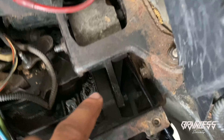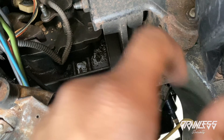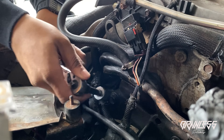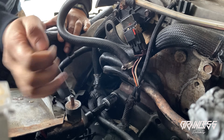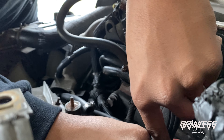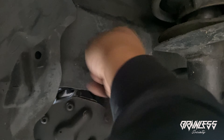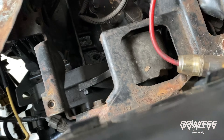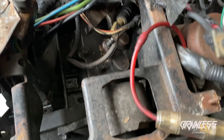As promised we are back at the SRT4. I went ahead and I'm taking the wheels off now. Like I said we got a buyer - my camera lady, I don't know, she's slacking today, she decided to just hop in the car. But like I said earlier in the video, we got four bolts - you can see the two here, one here, one here mounting it to the motor - and then we have this long bolt that's going to go through this trans mount. I might just take the bottom portion off of the transmission itself and leave that whole mount in so I don't have to worry about lining it up. Once we get these three or four bolts out, the trans will be out and we'll be making excellent progress.